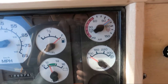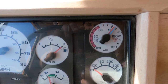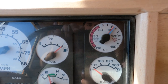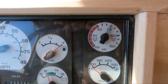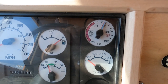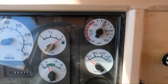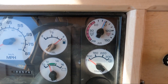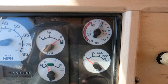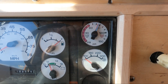Let's do the brake test. So now we shouldn't lose more than 4 psi throughout a minute, starting now. So that was a minute and I would say we just passed barely. I have to look at what is leaking. I think it's probably one of the front brake chambers, but we'll take a look at that a different day. All I know now is it's safe to drive, so I'm gonna reapply my brake and we're gonna get ready to go have a travel day.